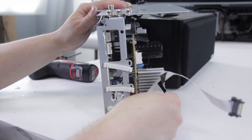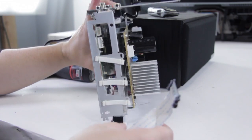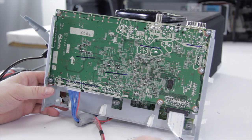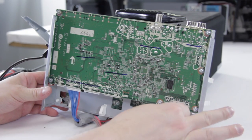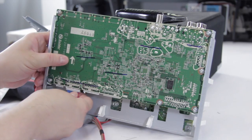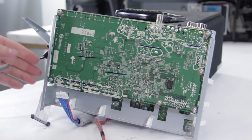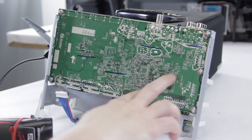And this ribbon cable is the one that takes the video signal from the main board over to the formatter. Next, you want to go ahead and remove the connector right here — just pinch the sides and give it a little wiggle and it should pop right out. Put that to one side. And then over here you just have this connector — squeeze the back and slide it right out. Now with those removed, you can go ahead and take our drill and remove the six screws at the corners and then two right here.